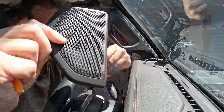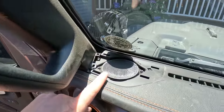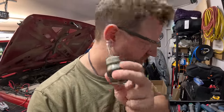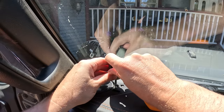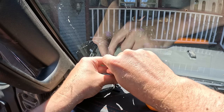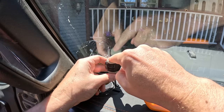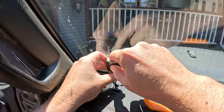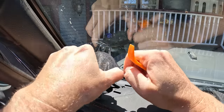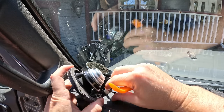A little dusty from recent travels — we even got mud on the dash. Once we have the grill off, we've just got these two screws here. That's going to be a bit hard to get to, but it looks like it just has a Phillips head on it, so we can probably use our little stubby Phillips head. I think this might be easier than trying to get the included tool in there. There we go, just pop those loose.